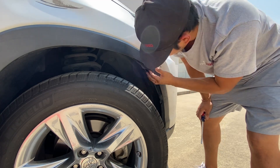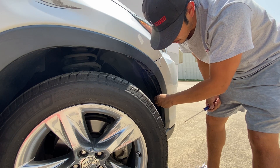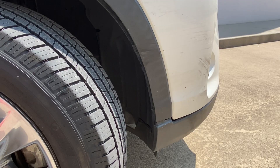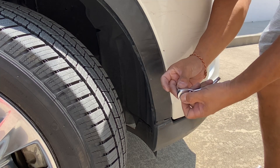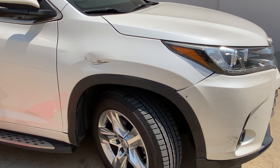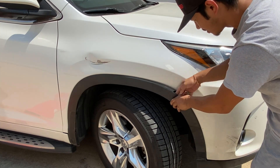Now we've got the back side of the fender — going to the front near the bumper. Remember there's one right here but it's already gone, and another one right here. Just follow it along with your fingers and you'll feel where every one of these are. That's the last one — right there it's going to be a 10 millimeter. Once those push pins and 10 millimeter bolts on each side are gone, we can go ahead and pull this fender liner or molding off.